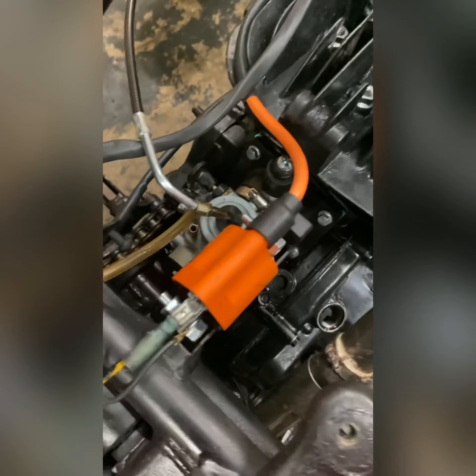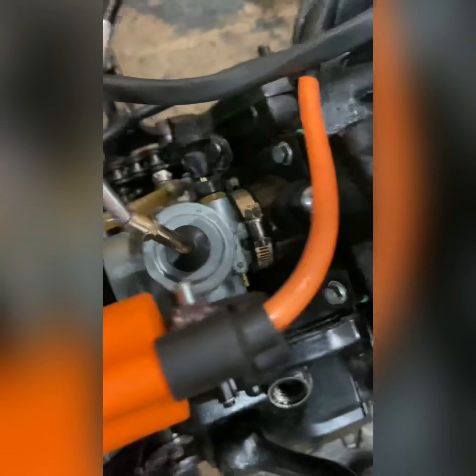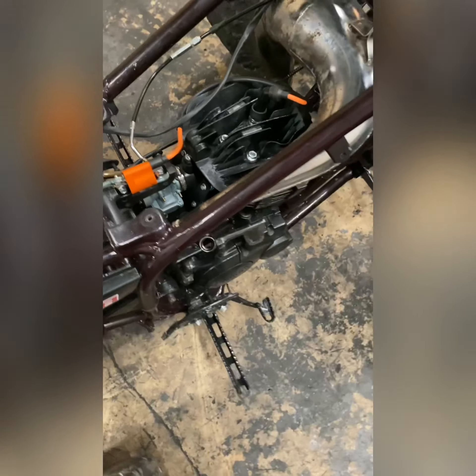So now what I'm going to check — I'm going to check the main things that will make the bike not have power, not wanting to go. So I'm going to check for compression, I'm going to check the spark, I'm going to check the gas, I'm going to run through the carburetor, and then I'm going to check the reeds, and we're going to see what happened.